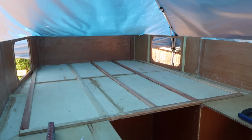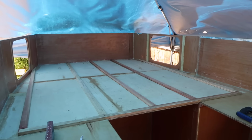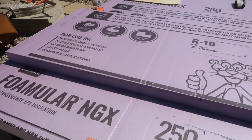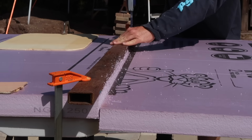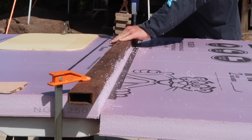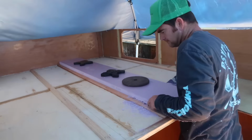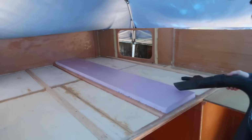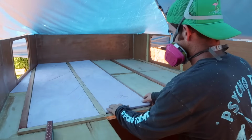The pour foam I've been using wouldn't work very well for this wide, shallow space between the Cabover frame, so it was fortunate for me we finally got some XPS products back in stock here in California. Unfortunately, it was only available in a 2-inch thickness. I found a basic handsaw cut through it pretty well, so I decided to use that to cut the foam down to the thickness I needed, using the Cabover frame as a guide. It took some effort, but produced acceptable results.